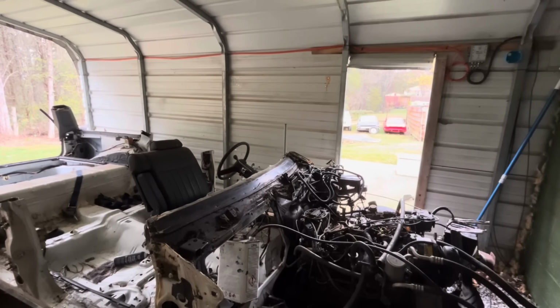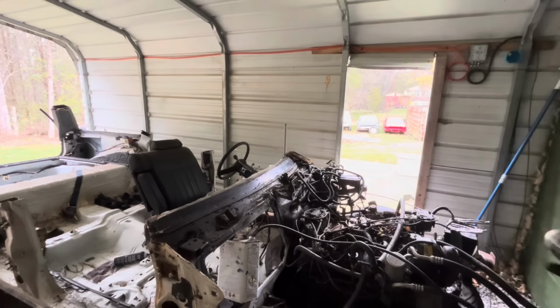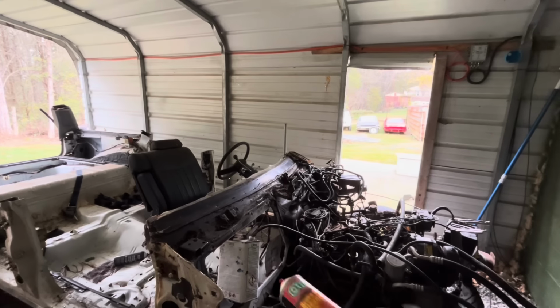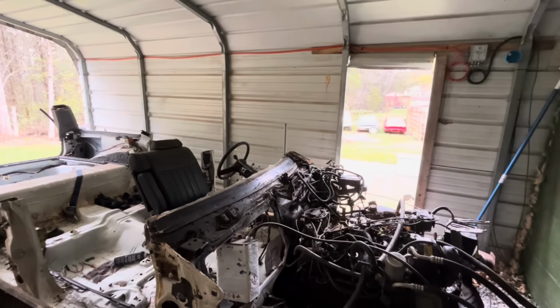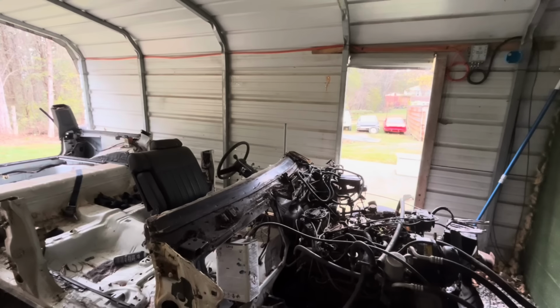All right. I got a battery, ratchet strapped and vice gripped to the frame. I gotta fill up my NASCAR proof fuel jug here in a minute. It was burning gas really quick, like it'd go through that gallon just bringing it around the shop, and then I realized it's because there's a return on the pump. So whatever gas is not burning is just getting dumped into the tank. So I'm gonna remedy that before I move it. I just wanna make sure it still starts.